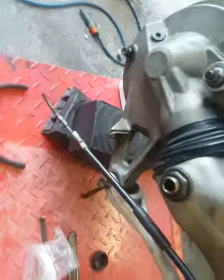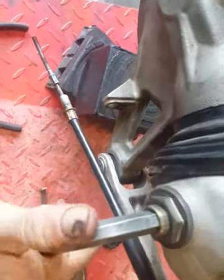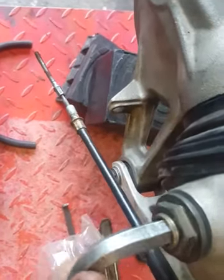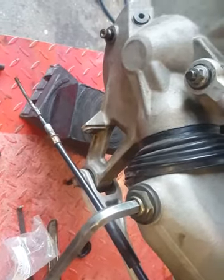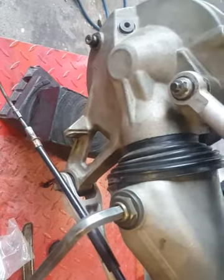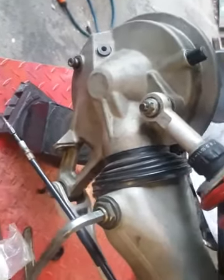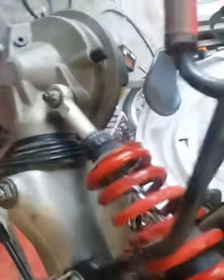I'm going to pause this again. The reason I paused the video is to go and get this Allen key, which is a much more precise tool, and I can feel just when it goes home. That other spanner is just too big and it's got too much inertia. You really don't want to have these rubbing. You don't want to have them with any kind of real preload on them. You want to have them just screwed down to the end of the bush and then just barely turn it into that bush so that it's kind of slipping against the end of the bush without having any ability to grab on it. What you're really trying to do is stop the side float between the two pins while still allowing the back, this part here, which is the main reason they have paralevers, to rotate around those pins, located by this locating radius rod here, and the shock absorber of course up the top.